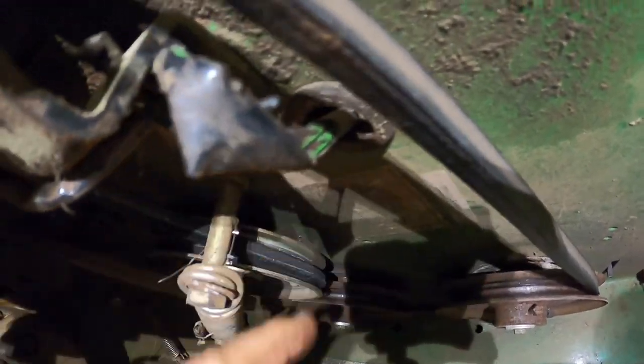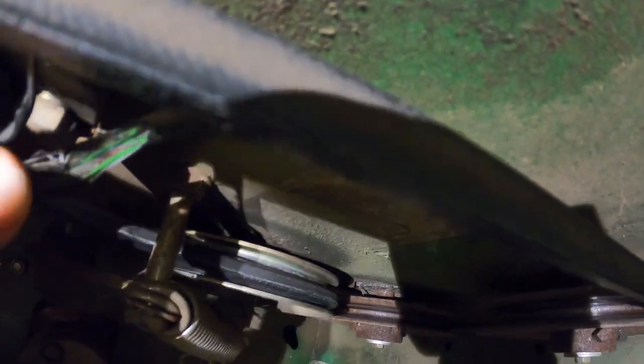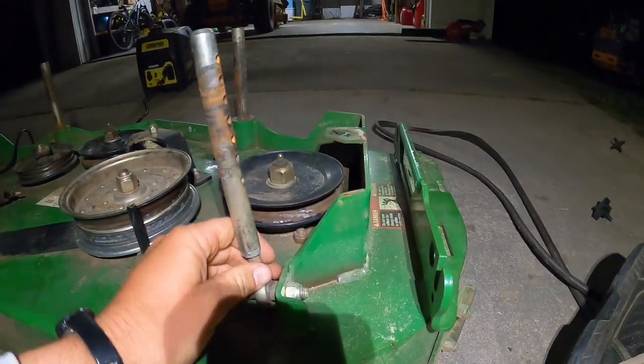Be sure you always look at things like this. This zip tie has just got old, and the wire coating is getting worn off. I need to separate those wires and then tape them up again and zip tie them out of the way.